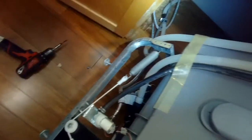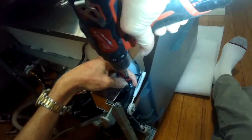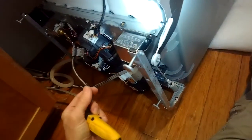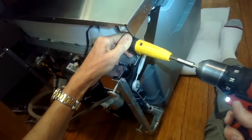I'm taking the whole dishwasher out of the cabinet and laying it on its back to show how to get to the main controller — though you don't have to do this; you can also just take off the front panel on the door. I'm removing the screws that hold the main controller: quarter-inch screws, two in each corner. Then I take out the modular connector on the bottom of the controller and another quarter-inch screw that's a little harder to get to — so I'll use my angle tool.